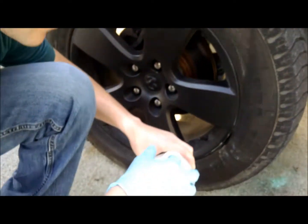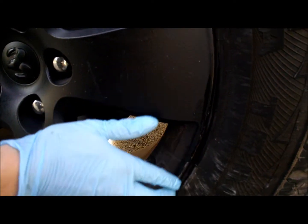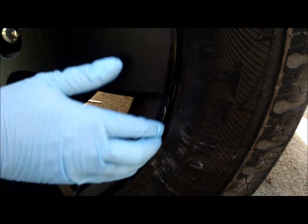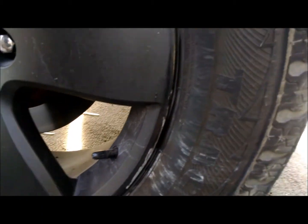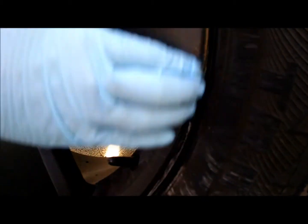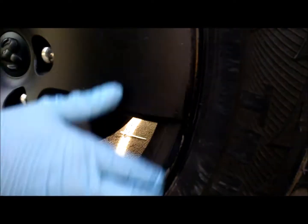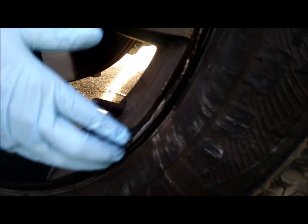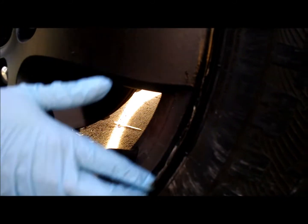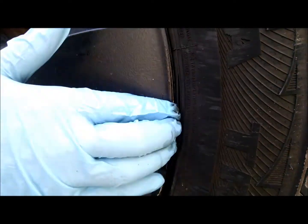Let's wet my finger and rub it along the edge until it gets smooth. I can feel it on my fingertips that it's kind of taking away the excess paint that was there. I just want to make it so I can paint it and there wouldn't be a raised level when I respray it. Just keep your hand nice and wet until it gets smooth, then I'll run some mineral spirits to clean the area and respray it.